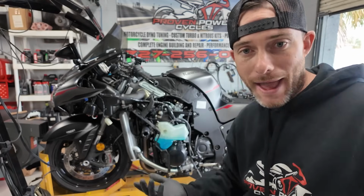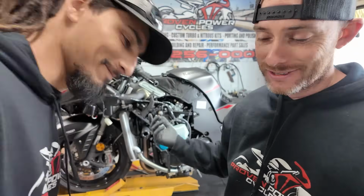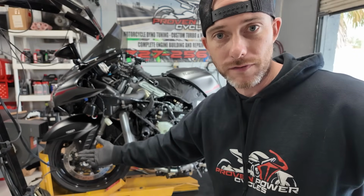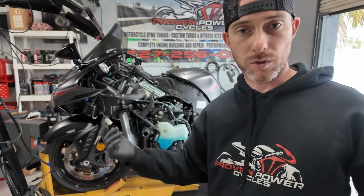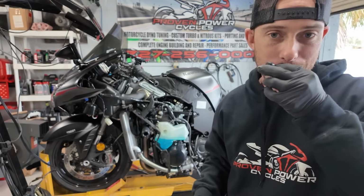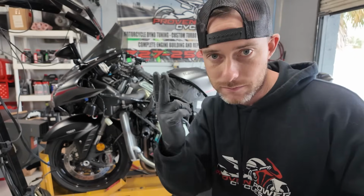Quickly, what ended up happening was just one of the sensors for the idle wasn't plugged in. It got unplugged during the removal of the stuff when Lewis was installing the quick shifter or something like that. Again, stupid little mistake. Figured it out in about 2 seconds.